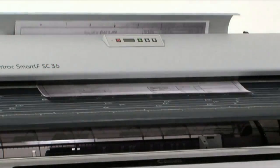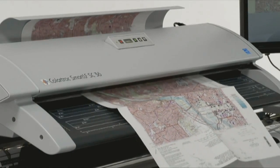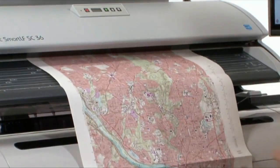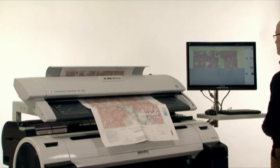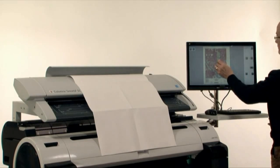We will now show you how to scan, edit, and save workflow without having to re-scan the original document. Select document type, colour map, insert original into scanner, enable preview, and then press the green scan button. You can change the document type from the preview window, and this has the effect of changing the white point, black point, and sharpening levels.